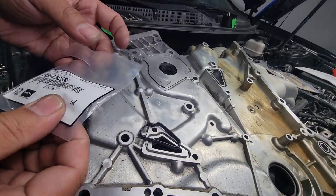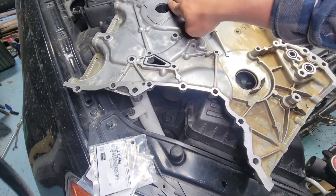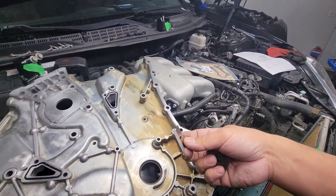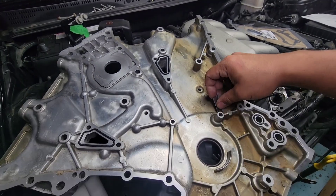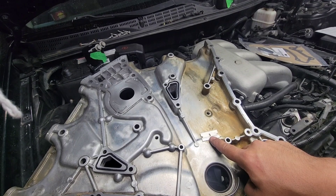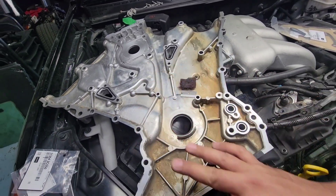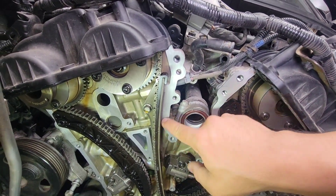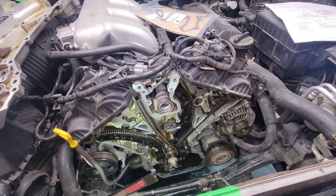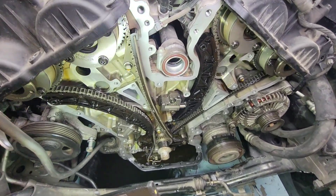Let's quickly install this gasket. You can see all the old gaskets are gone — all cleaned. It's nice and smooth, same thing on the engine side. What I use is first a brand new razor blade — it has to be brand new; don't use an old one, it'll scratch the aluminum. After that, brake cleaner to make it soft, scrape it with the razor blade, and then scotch-brite to make it nice and smooth. Spend about 30 to 45 minutes on the cover and the engine side. You want to make sure no old gasket is left in there before you put a brand new silicone gasket, or it's gonna leak.